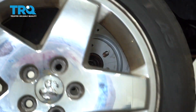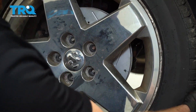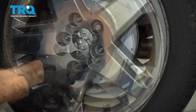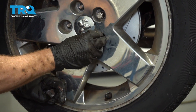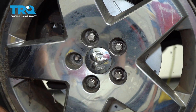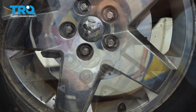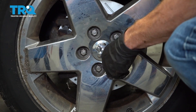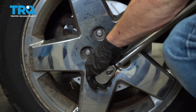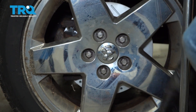Let's get our wheel up on here. Start on all of your lug nuts, then we'll bottom them out. Once they're bottomed out, we'll get the wheel on the ground and torque them all to 100 foot-pounds. Okay friends, we got our tie rod back in there. Now you're gonna go ahead and safely get yourself down to your local alignment shop. Good job.